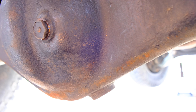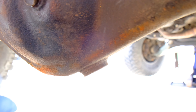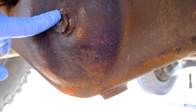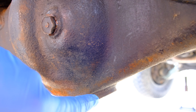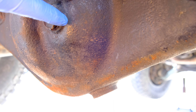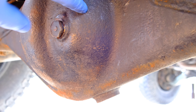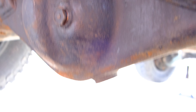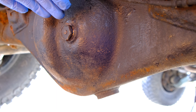Once you're under the rear of the truck, there's a fill bolt and a drain bolt. What you're going to want to do is make sure you can crack the fill bolt loose first, because if you drain the oil and you can't get the fill bolt open, you won't be able to fill the diff back up — which is bad news. You're also going to want to run your truck for about 30 minutes to get the oil warm so it helps drain. Then you're just going to put your pan under the drain bolt and start removing the nuts.